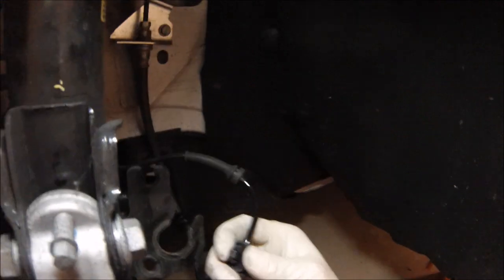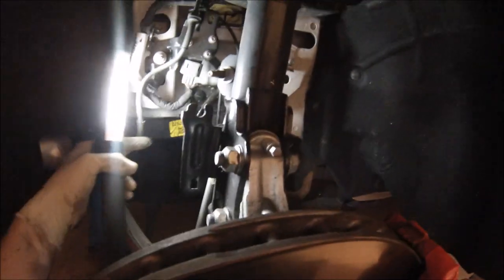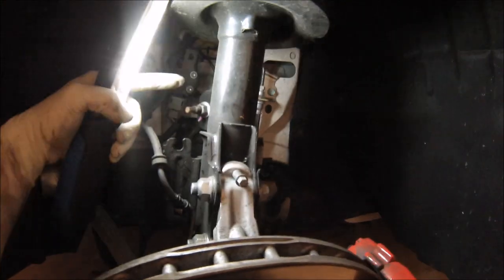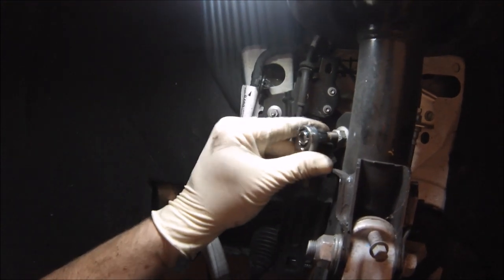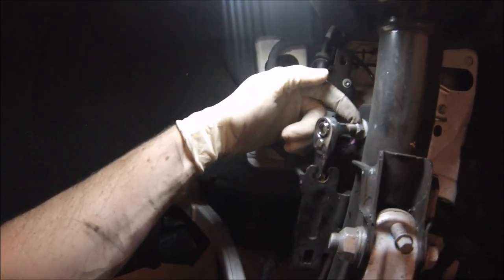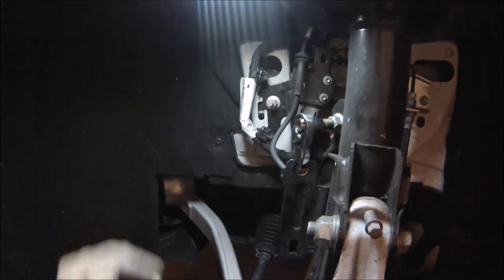The tabs on both the MagneRide as well as this ABS line — the best way to do this connector is to squeeze the pins and pull it out. Try not to break it. You don't want to break pieces on a newer car. So now we got everything disconnected from the shock itself — all the electrical, ABS, and brake lines. We're going to start with taking the sway bar end link off. Quick little pro tip: the sway bar end link has this nut-style tip on it. You can use a wrench or a socket — this is 7mm and this is 14. You can't just simply loosen this bolt as the whole assembly spins.